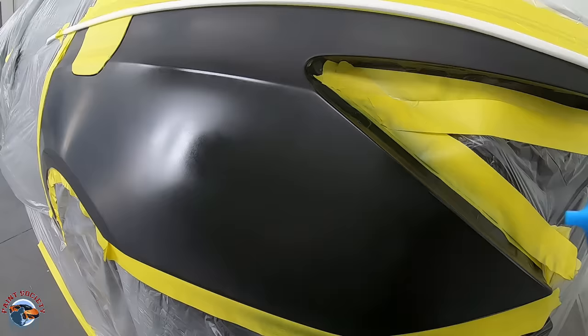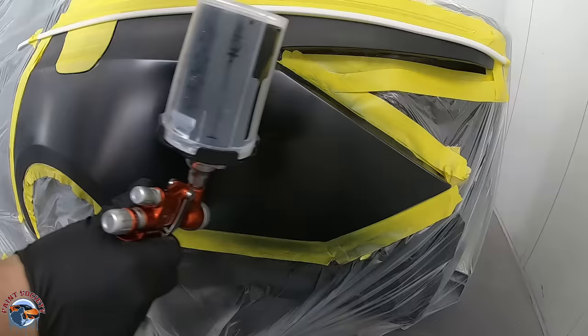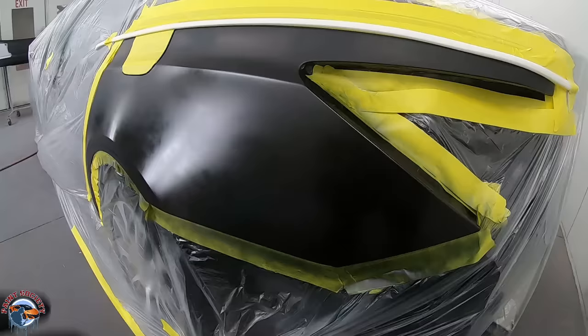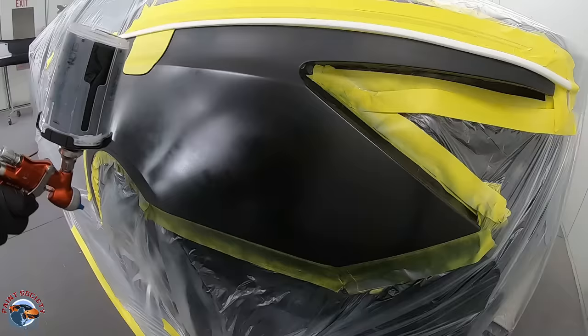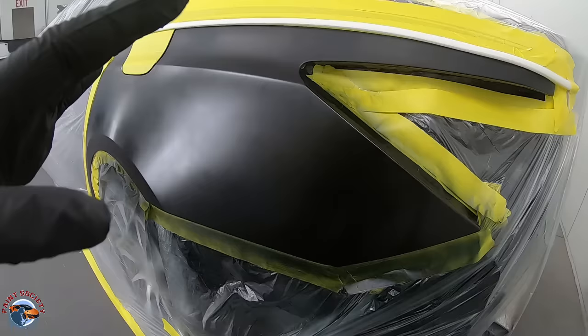Let this flash for a good five to ten minutes. Our second coat is going to be very similar - just very, very light passes. I'm going to leave it at that. Second coat done. For my third and final coat I'm going to come a little bit further but still keep it low. We always say get coverage plus one coat. And that's it - leave it alone. It looks good, we don't need to mess with it anymore.